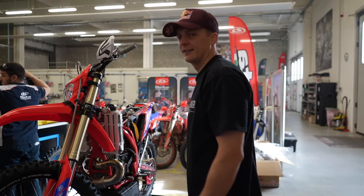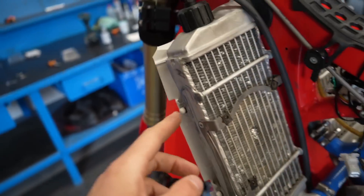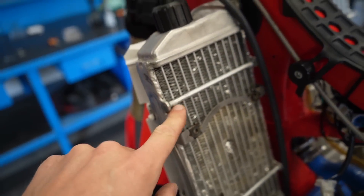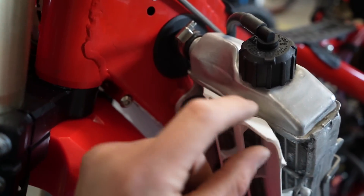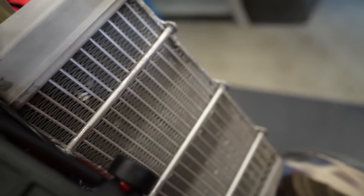I'm going to show you my radiators. The radiator doesn't look the best with the fan off, but I've got a rad brace welded onto the side, running across the back. We also notched the radiator here to get more steering lock — when I ran the rad brace on the front I had less steering lock. We did that on both sides, so you can see the steering lock goes right in.